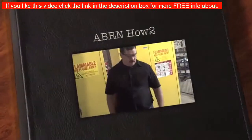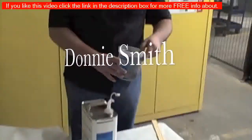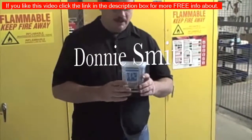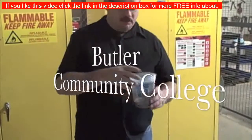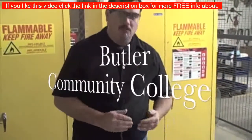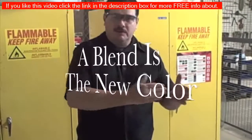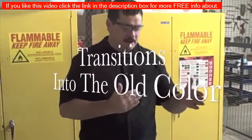Today we're going to show you how to blend paint. The first thing you want to do is mix your paint up and make sure that it is a blendable color — really close to the color that you're painting. The fender we just painted is silver and this one does not match; we on purpose made it not match for the demonstration, but normally you want to get it as close as possible. A blend is where the new color transitions into the old color, kind of like a fade.